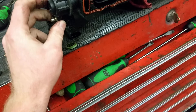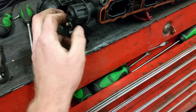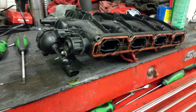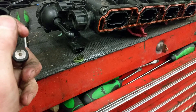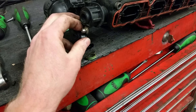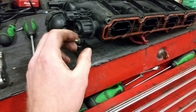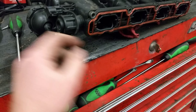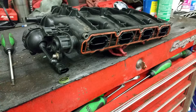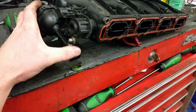If you firmly push you can get something close to the proper movement, but you can still see there's some slack. I'm pretty confident that if replacing the intake manifold was not financially viable but you could do the labor yourself, you might be able to take this armature out, clean that hole up, get some epoxy in there, slide this in, let it cure — and you might get it to work. The hardest part is that you cannot tell the position of the flaps at the moment you install the armature, so it would be a complete gamble. But I think I might try it on one of these soon just to know exactly what my options are going forward.